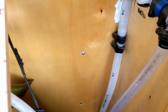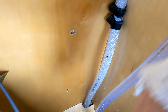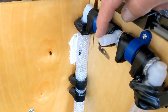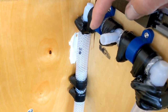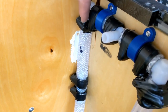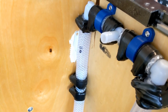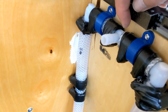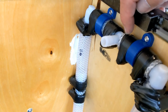The gulpers pump up this line and then down into the tank. This is going to be a vacuum breaker vent here. Say the greywater tank was very full and you parked someplace — you wouldn't want to get a siphon going that siphoned all the water back out of the drain into the shower and flood the van. So this will have a one-way valve that lets air in but won't let water out, making sure the siphon gets broken but no water comes out.